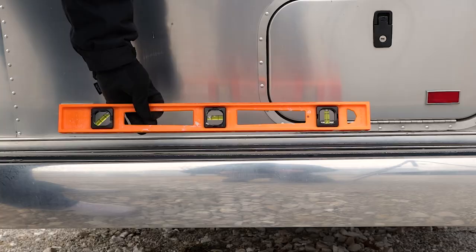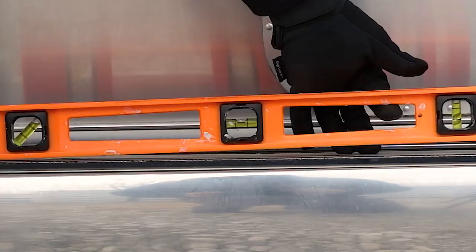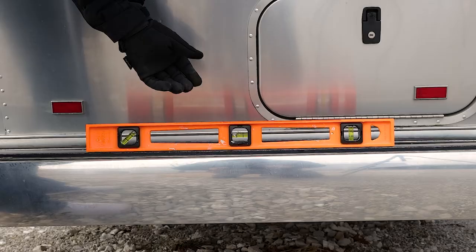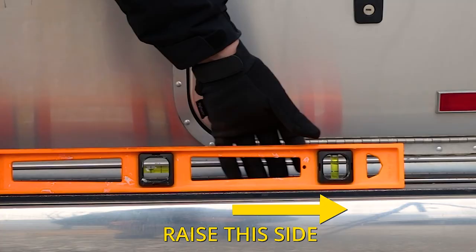The first thing you're going to want to do is level your camper from side to side while it's still connected to your tow vehicle. You can see here we are a little bit out of level, so our camper needs to come up on the passenger side just a little bit. The best way to tell is to use the bubble level on your camper if you have one on the front and the side, or like us, you just pick something that you know is level — such as our bumper here, which is attached to our frame — and lift up on one side. If you have a gap, the side with the gap is the side you're going to have to add blocks to.